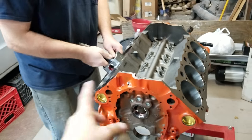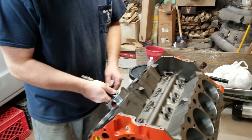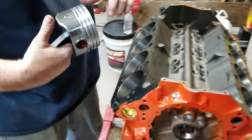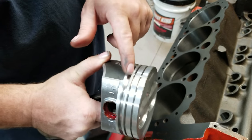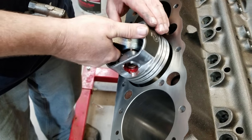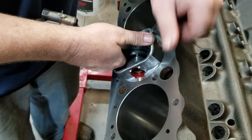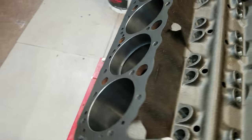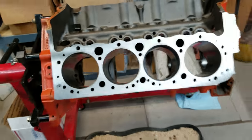I probably have the whole motor complete. What you have in the big block — what I'm doing, I'm pushing the — they say about an inch, but I'm going to be even with this. I'm going to put the piston ring down in there, push that down. I like to keep it flat a little bit. You can keep it down about an inch, but I'm an inch and three-eighths down there, so we're good. I already did the oil ring — that was not fun.